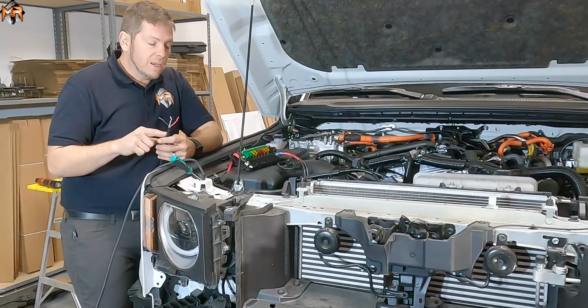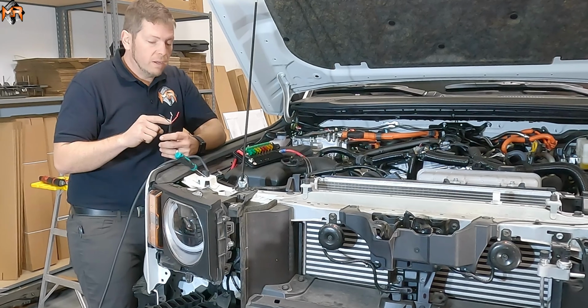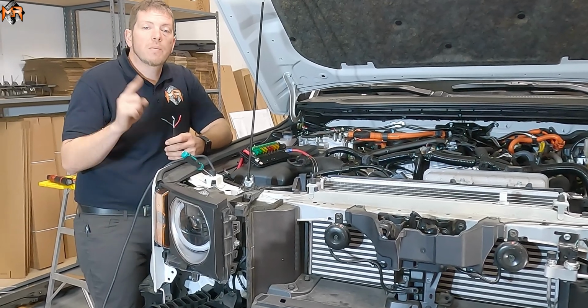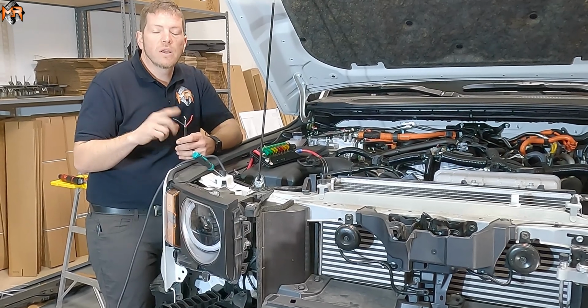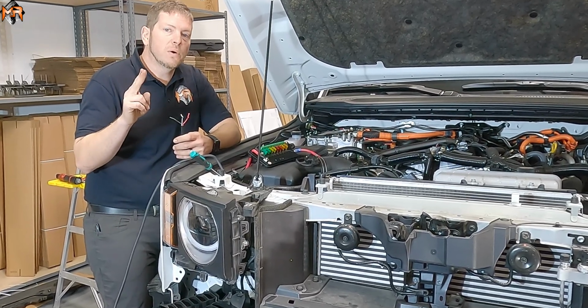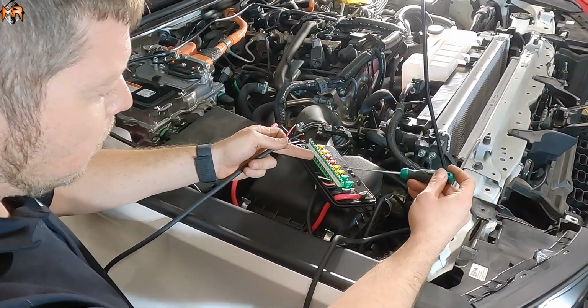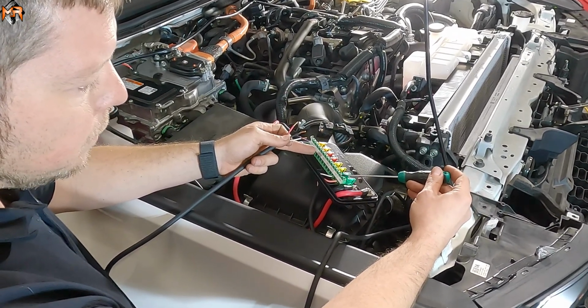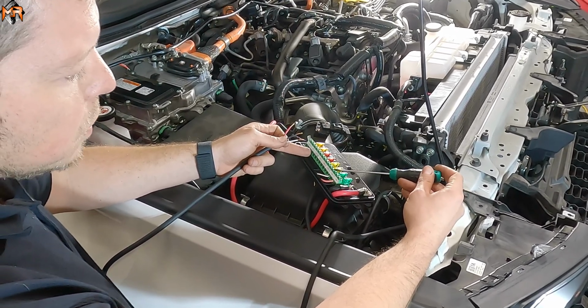So now that we have the second light bar wire inside, you can connect it to the wireless control panel the same way we did for the first, but I'm going to actually switch things up a little bit and show you a new technique just for variation. We're going to connect the DRL for both light bars on one power source. So as you can see here, the first light bar, we connected the positive on switch number 1, we grounded on switch number 1, and switch number 2 was our DRL.